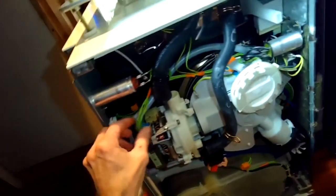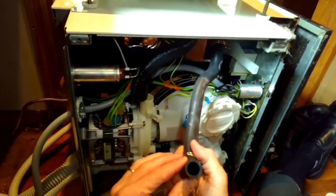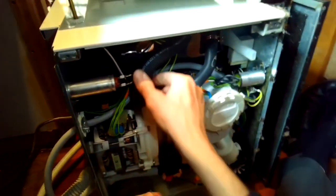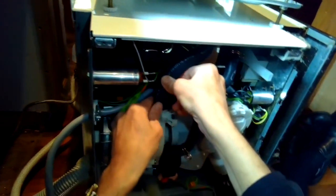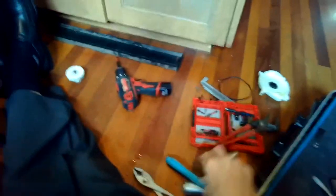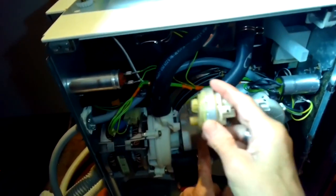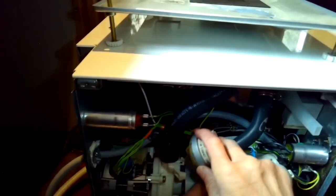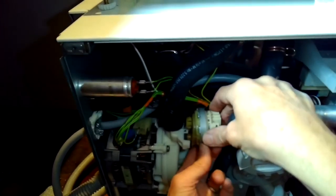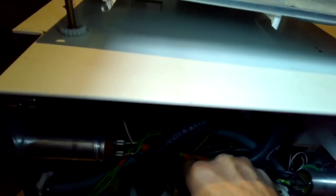We got to make sure to put that screw in. We're going to start putting everything back on. The hoses. There. This one goes here. Heater pressure switch. So we're going to push it in this way, and then we're going to turn it 90 degrees, and this is going to click in right here. I'm going to make sure that thing clicks in. So I'm going to put this in this rubber grommet. First step, and then I'm going to rotate, keep pushing in until that engages.